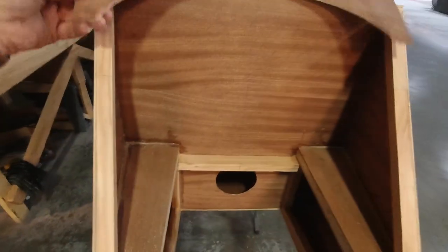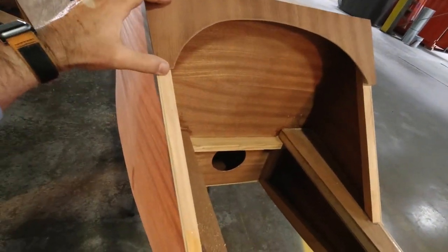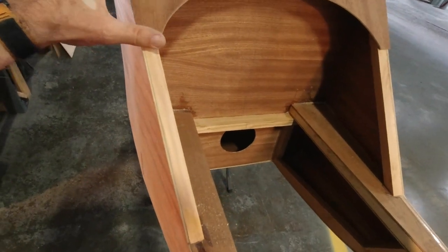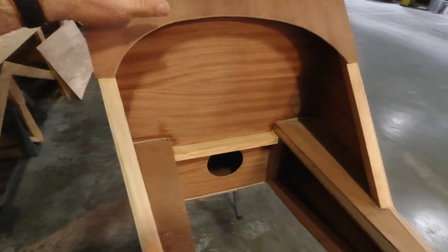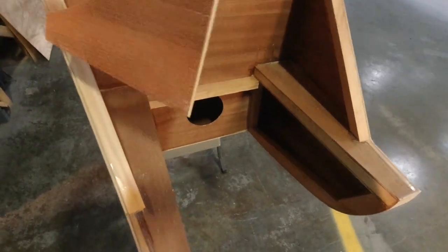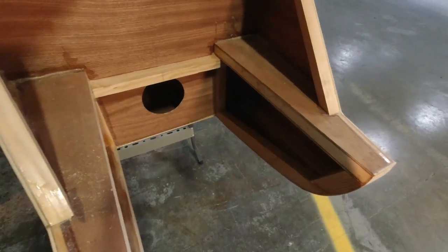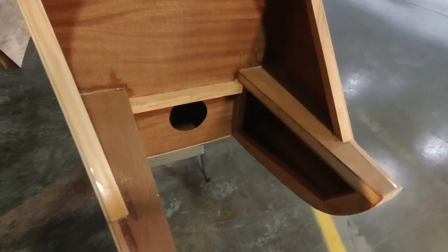I made this piece that goes right here — it's a pretty simple piece, just six inches wide, with this curve in it where it clears right here for the magneto, which sits kind of right in this area. I just beveled the edge of it 45 degrees so that it sits nice and tight up against the fuselage, and that'll be pretty easy to get into place.